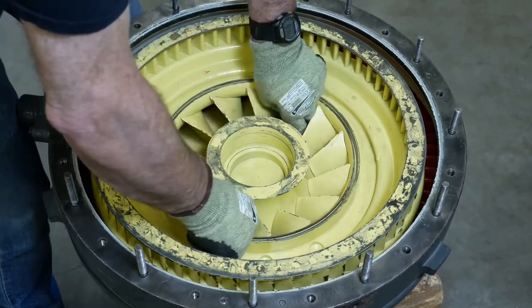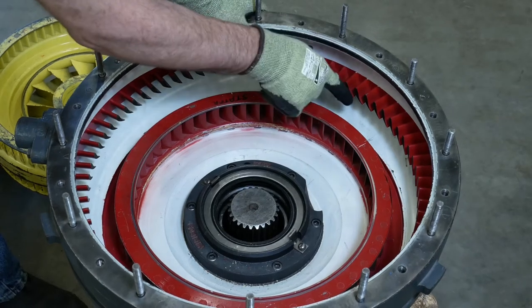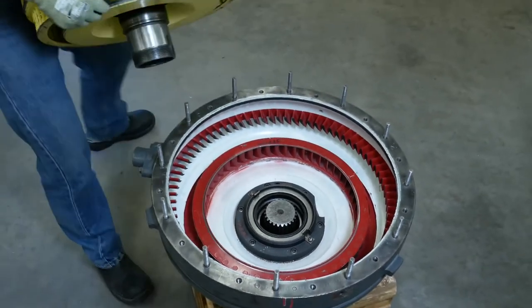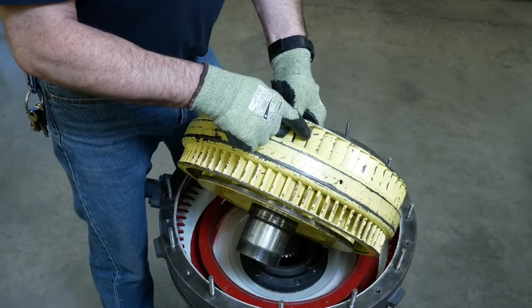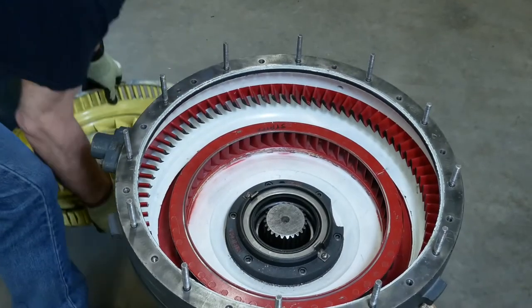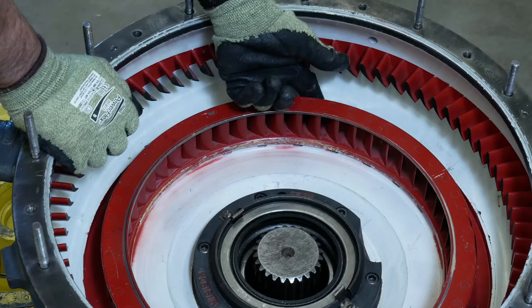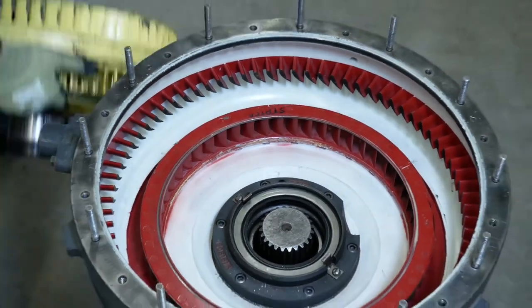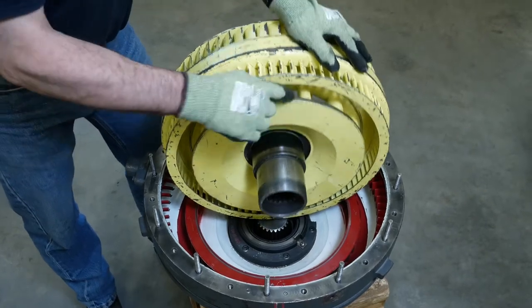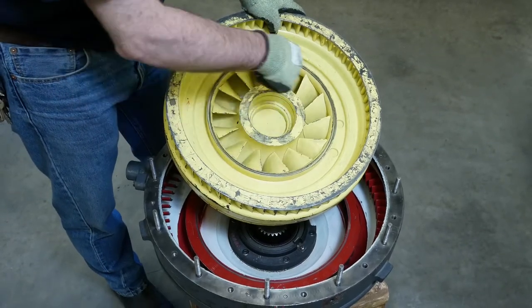Lifting this turbine out — oil comes through the turbine and hits this first set of stator blades. The job of the stator is to redirect the oil. The oil comes out on this side of the stator, then hits the concave side of the wall and is redirected to a second set of blades on the turbine. From that set of blades, the oil is directed to a second stator, goes through it to the inside, and at that point hits a third set of turbine blades right here.